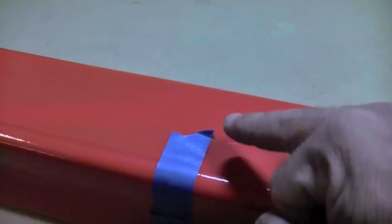It is important to note that the force is applied inside the fuselage tube, rather than, for example, if the piece of angle aluminum was sticking out and you put the clamp here, it would tend to push down and cantilever off that corner there. And so the portion of it that was in the center of the fuselage tube here would tend to bow up, and so the adhesion wouldn't be as secure here.